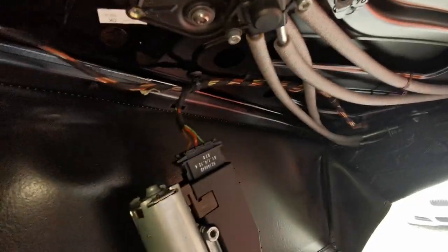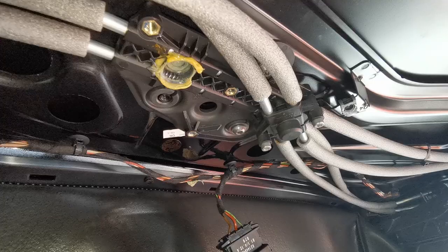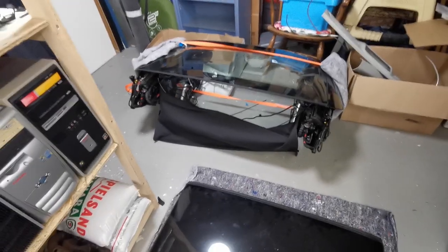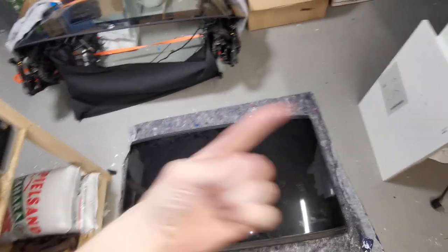The rest is down here with all the shims except for one shim in the far corner that we have to retrieve. The sunroof motor needs to move — well, the spider needs to move. The roof panel is completely undone in the car — just two bolts of the spider remain, plus the motor itself is three bolts.